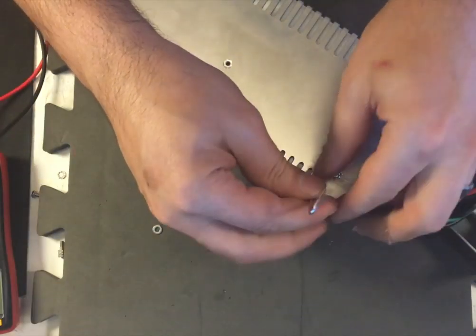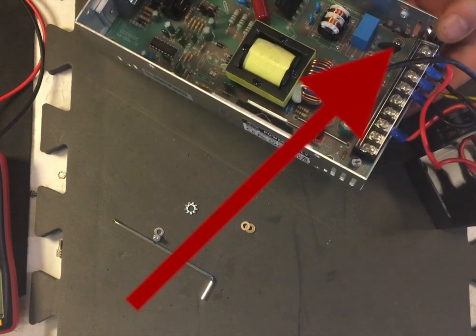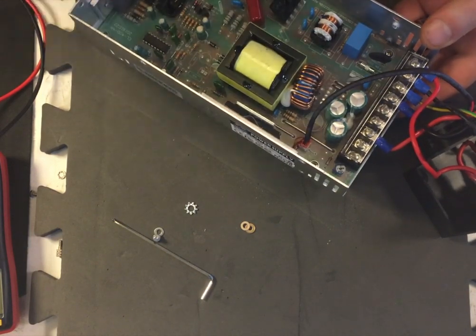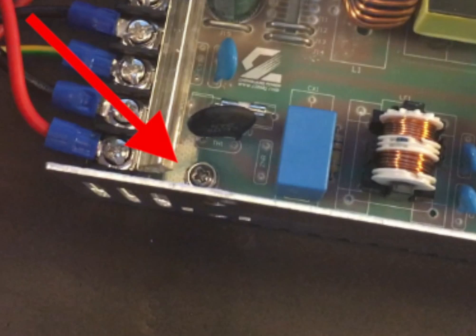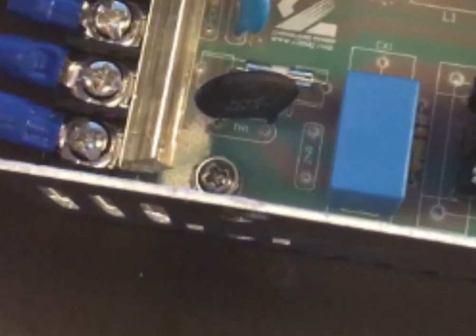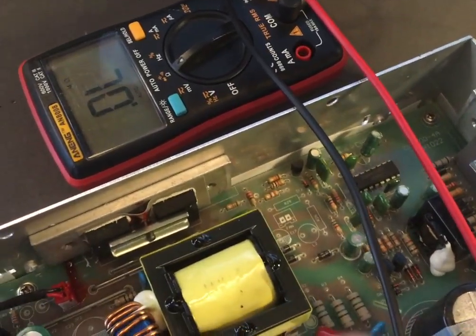I was trying to find a quick safety fix without disassembling it. There is a problem though: when you thread that screw in from one side, you can thread the screw that mounts the board from the other side, which connects the safety ground through the board and then to the chassis — that's not the best design. Safety grounds should be connected directly to the chassis, as close to the outlet as possible. Also, there was nothing to retain the bolt, so I put a toothed washer on it — safety ground connections should always have a toothed washer or lock nut. I checked and there doesn't appear to be a ground reference between safety ground and the board grounds, which is good — it's a separate circuit.